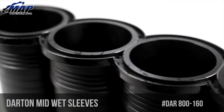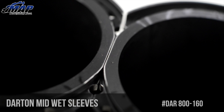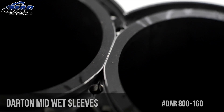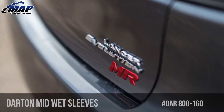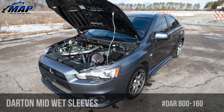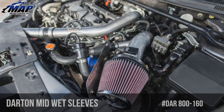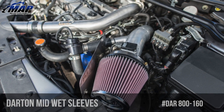Let's explain the Modular Integrated Deck feature. If you notice, the top of the sleeves are notched so they go flush up against each other, providing a full rigid structure when assembled, but still able to be replaced individually if needed. The top flange has coolant passages, and the outside surface of the sleeve contains fins that help reduce heat soak within the sleeve, helping keep heat out of your internals where it could cause cracking or warping.